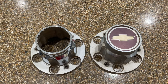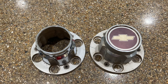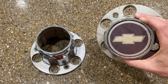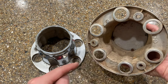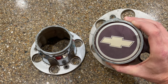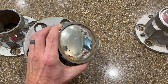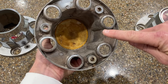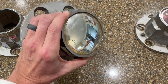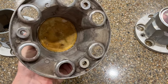So I've got a little bonus for you guys here on these open-faced six-lug center caps. Now earlier I told you that you would have to replace these open-faced ones if you're putting these on a two-wheel drive. That's true, but you can do some modifications and make them work. If you take a look at this bow tie center cap here, this is actually an open-faced four-wheel drive cap. What they've done is gone through and put a piece of aluminum or metal in the back, got some sheet metal screws and wedged it in there, and put a little hot glue around it. Does it work? Yes it does. Now if you want a blast from the past and step back into the 1970s, you can also put these mirrors in here — just run down to AutoZone or O'Reilly's, pick up a three-and-a-half-inch peep mirror, slide it in from the backside, hot glue it, and you're in business. It's an option — just not one that I would ever use.